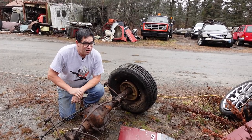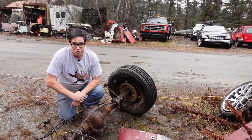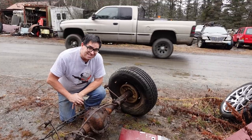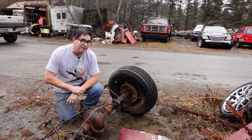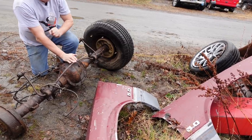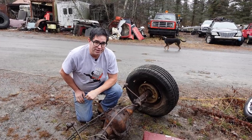These first launched in 1983 under mid-sized Ford pickup trucks, SUVs, Rangers, that kind of stuff. And in 1986, they were found under 5-liter Mustangs, like this thing right here, where their 8.8-inch ring gear was strong enough to handle the 302 fuel-injected engine's torque.